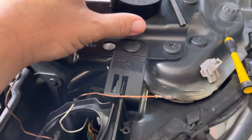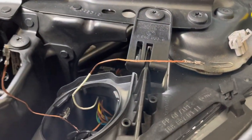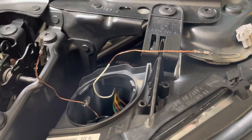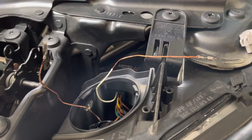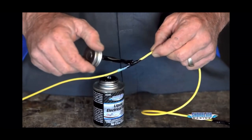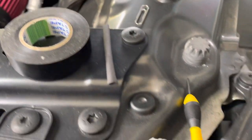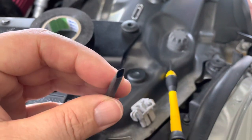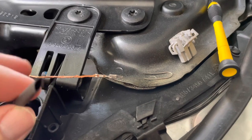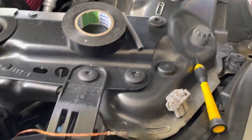So first option I considered would be to use electrical tape, good quality electrical tape, wrap that around each wire, and that'd be a good interim fix as well. I just thought it might look a bit messy. I wanted a neater solution. At least you wouldn't need to disconnect the plug to do that, so it would be the easiest to do. Another option would be to use liquid electrical tape, which also perhaps you could do without disconnecting or dismantling the plug. But the option that I chose was to use heat shrink, and this is the size I've discovered I need to use to fit over these connectors here. It's obviously a lot bigger than the wire itself, but I need that to fit over the end. So I'll leave the details of the size of that heat shrink in the description.